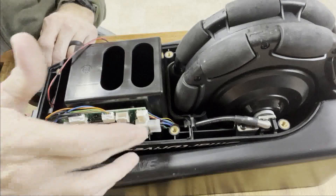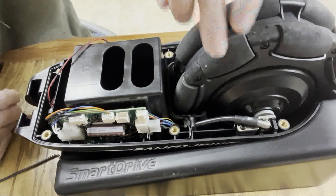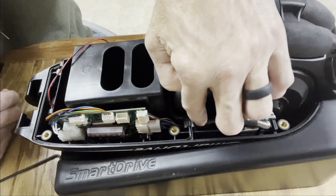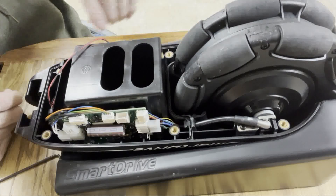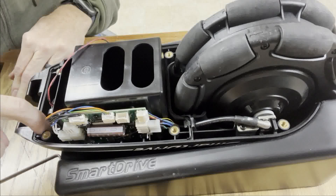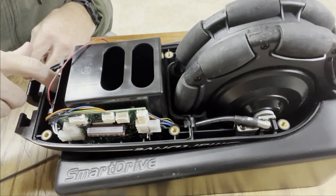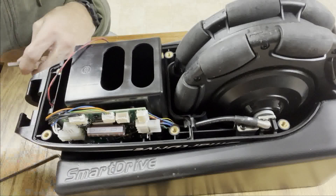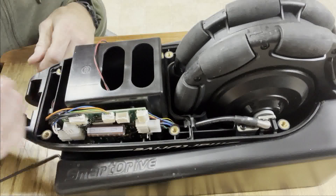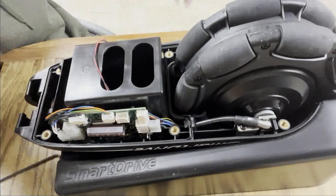After removing the cover, note the brass inserts. Unplug all the connectors. There's an o-ring that runs all the way around the outside, and the most common place to get water is right where the wires come from the hub motor in the back. Check that, and check the front as well. There's a board for the LEDs, many conductors from the charge port for speed control, and the on/off switch is just two white wires. The horn is already unplugged. Use a T20 torx to take out the four bolts and remove this box.